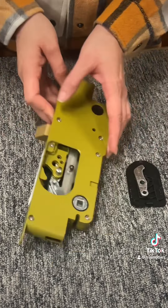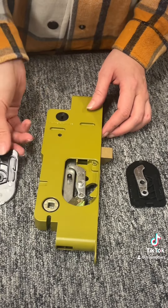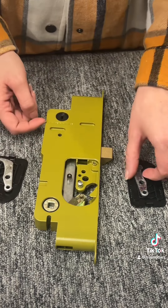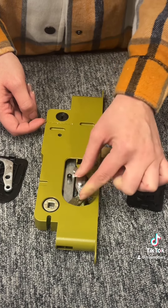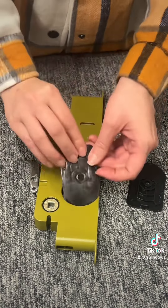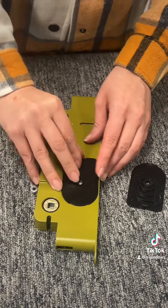This one's the short side. Flip it over, open the panel, and you're going to remove the other lever which is longer. Next you're going to take the shorter version, flip it, and put it back in — it goes onto two posts. Make sure that it's seated down all the way flat, and then install the panel again.